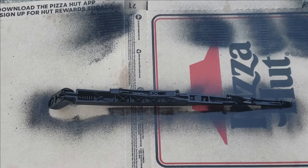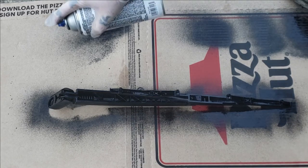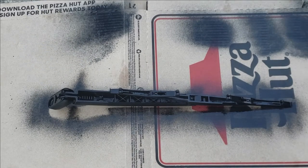This stuff is easy to run, so you want to take your time and put light coats on it. You can sag the paint if you go too heavy. I went a bit heavy on this bottom coat, but I'm only doing it once. I'm going to give this a 15-minute flash time, flip it over, and do the top. If you've got it hanging, you can just do light coats on the whole thing without flipping — that makes it much easier. You can hang it and spray three times all the way around.